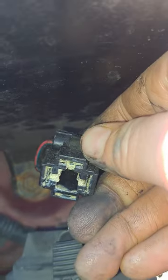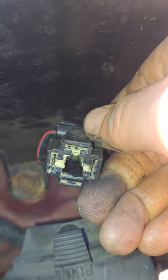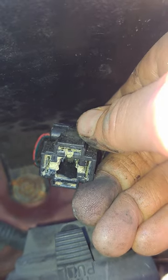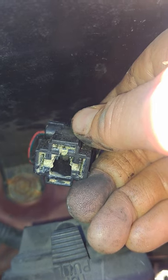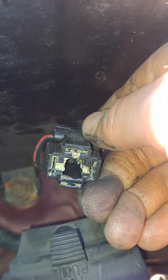This is just a quick upgrade. But if you notice a lot of corrosion or anything, take a wire brush and a little bit of electrical cleaner and clean those up — it can cause a failure in the long run. Then after you wire brush and clean it up, throw just a tiny dab of your dielectric bulb grease in each of those slots.